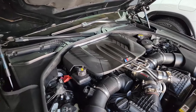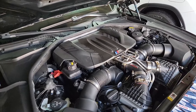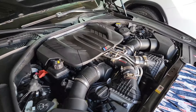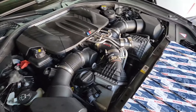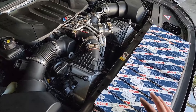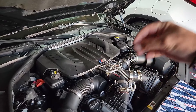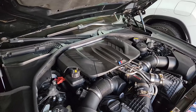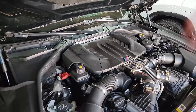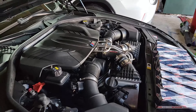The car has about 61,000 miles on it. As you guys remember, the engine was replaced at 33,000 miles. I checked all the records and it doesn't look like the fuel injectors were replaced — only the couplings at the bottom were listed as replaced. So I believe these injectors have about 61,000 miles on them. I like to do as much preventative maintenance as possible, especially because injectors on these cars are known to get stuck open.